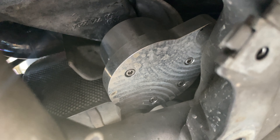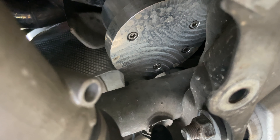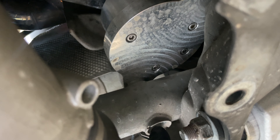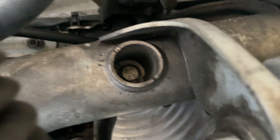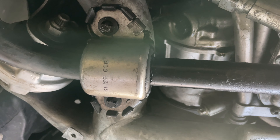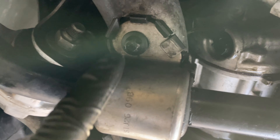If you see there, those are my engine mounts — I'm going to undo those bolts. I went with the poly billet engine mounts, so my bolts are 13mm right there. I can't remember if it's the same for OEM. But anyway, take this one out and the other one, and same on the driver's side — right there. So just take out that bolt and that one.